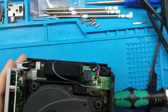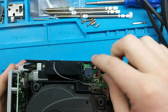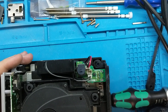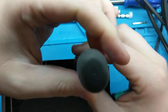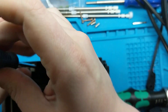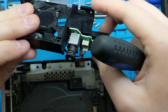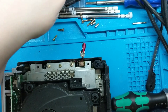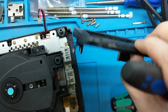Now we have the fan. The fan just has two screws and a wire that needs to be undone. Grab the wire and give it a little tug — it'll pop right off. Then using a number two screwdriver, or a very good number one, remove the two screws on either side of the fan. Once those are out, the fan will lift up. There's a little hook the power wire goes through — maneuver the wire around it and set the fan aside.